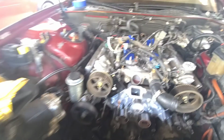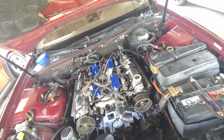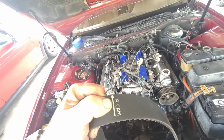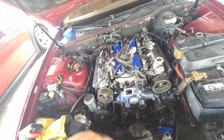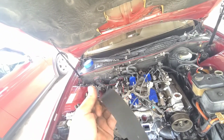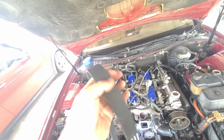Now, a lot of people don't realize on these LS400s, excuse the lighting, my camera's all messed up, but a lot of people don't realize when it comes to the timing belt on these cars, they got timing marks written on the belt. Some cars don't offer that, and we have to take white out and mark that spot wherever the mark is on the gear. And then once we get the belt lined up, then we mark on the belt. But I love about these cars, this is my second one doing. My brother's car, I did his when he first got it. But left cam, there should be another one down at the bottom.